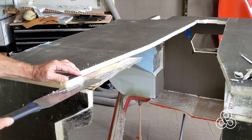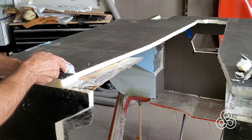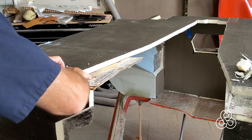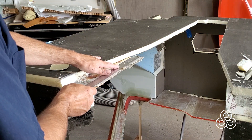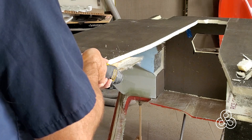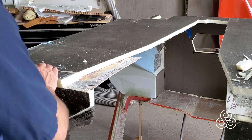I need to trim out and clear up all the mess that was hanging off the bottom of the tray while that fitment was going on. Now that we have it turned upside down, we have the opportunity to clean things up nicely. We're going to lay multiple layers into these areas to create a thick, strengthened area for those transmission mounts. Once that reinforcement is done, we'll add some larger pieces of fabric that cover the whole bottom of the tub on the bottom, and that will tie those smaller pieces all together.